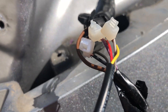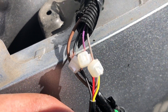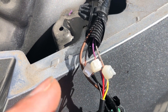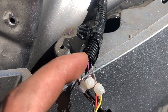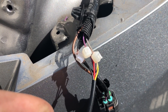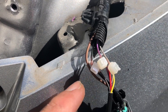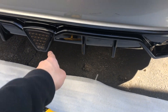So that's how it looks — take a screenshot if you want. To recap: black on black, brown leave it, purple with red, gray with yellow. Temporarily put zip ties to make it really tight so it stays there, then take them off, put electrical tape, and heat it up so it stays good. Connect this back into the taillight and push it back in.